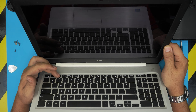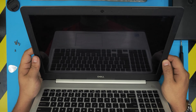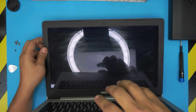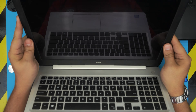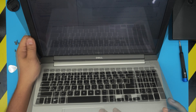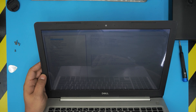We have two RAM DIMMs in here — DIMM A and DIMM B. To remove the RAM, it's really simple. Grab the two retaining clips beside the RAM and pull them away from each other. The RAM will pop out automatically at a 45-degree angle. Grab it at that same angle and pull it out — don't yank it toward the ceiling or you'll crack the DIMM slot or break the RAM.